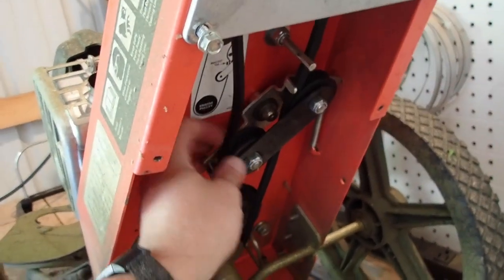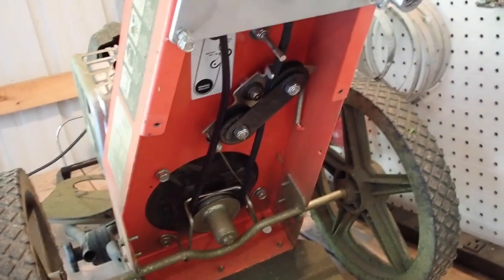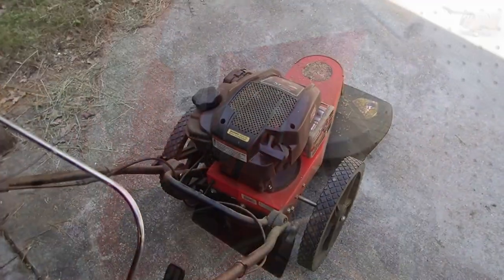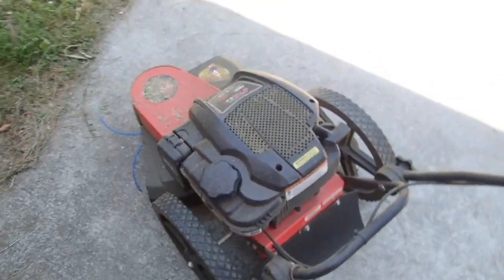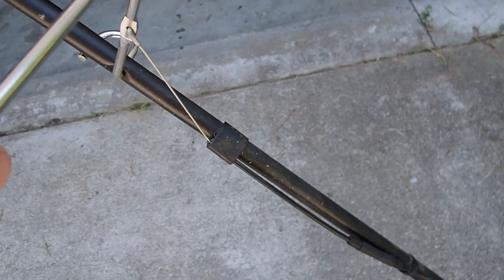The reason I was having to replace my belt was there was maybe a little too much slack in it. I was doing the adjustments up on the arm and just couldn't get it tight enough to spin when the trimmer was resting on the ground. So I'm swapping out the belt and we'll see how that turns out. This is where you adjust your tension on the pulley system through the cable line — when you pull back on the trimmer head release bar, that's what makes it tight and allows the head to spin.